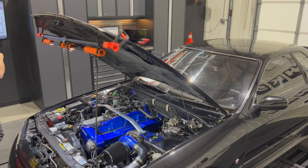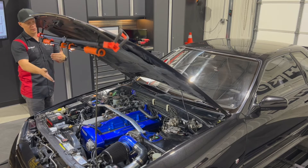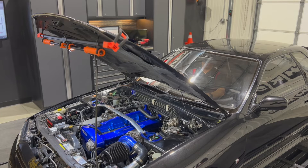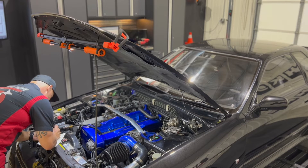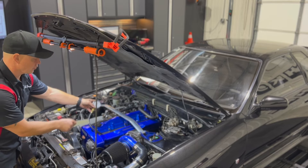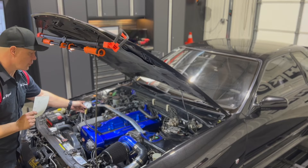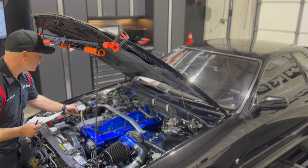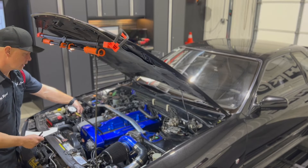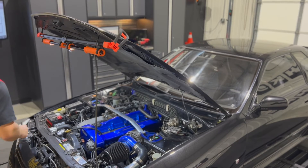CAS disconnected, fuel injectors turned off in the ECU. I'm connected into cylinder number one. The method: warm engine, wide open throttle, all plugs removed. Cylinder one read 175 psi — signifying a very healthy cylinder. I wrote that down, bled the pressure, and moved on to cylinders two through six, repeating the same process and reporting numbers as I go.